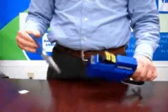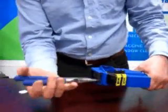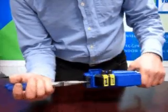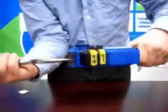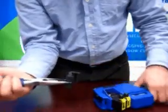Once you've got that piece somewhat elastic, go ahead and grab it with your needle nose pliers. I typically hold the needle nose pliers in the center of that grooved panel, squeezing the other side of the inker assembly like that, and then twist and wiggle — that'll pull the inker assembly out.